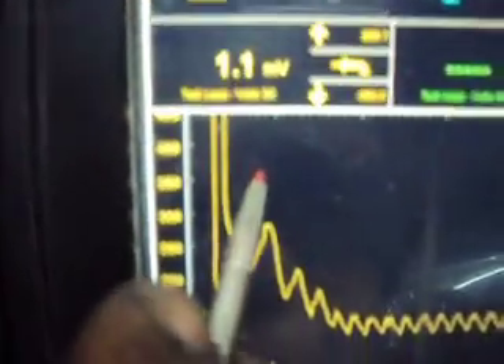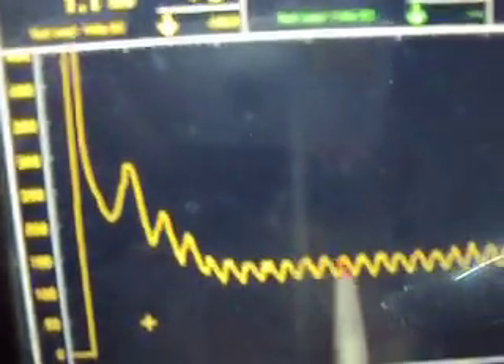That's plenty long. We'll stop the scope here and roll it back. So we took a little — probably close to like 500, 600 amps to get the starter rolling. And then as we got it moving, we got a nice even waveform.